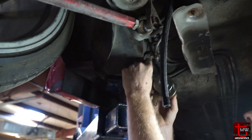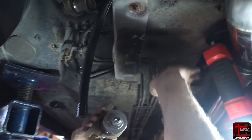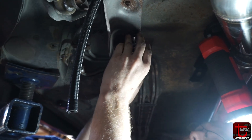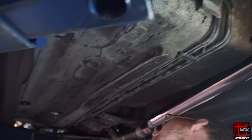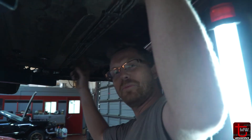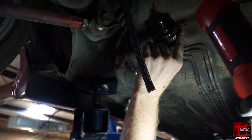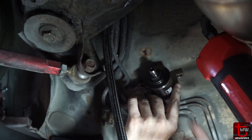I'm debating whether I'm going to go in this factory spot, or — we don't have any hot parts extremely close here, so it would be fine in this area if I remove this heat shield. That straight ripped open there — that's not really going to affect the car, but it's not a good sign for fuel lines you're about to put right there. I've decided on the spot — I pulled that heat shield off. I think that's going to go right there, and I'll use this fitting at a 45 degree angle — looks like it'll be a perfect shot right there. Then here I'll need to use another 45 degree.